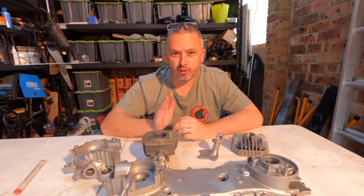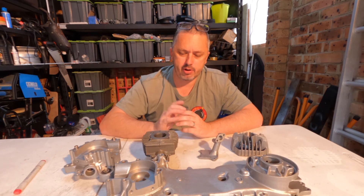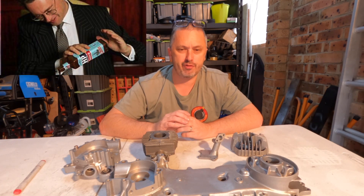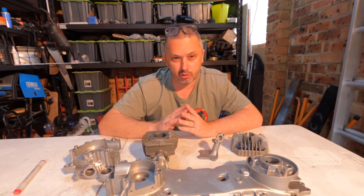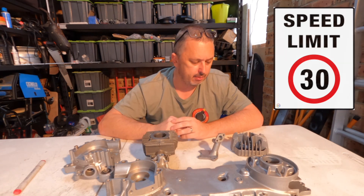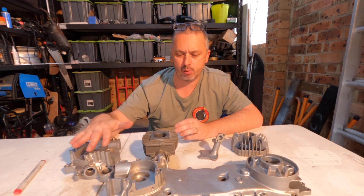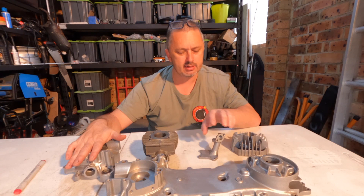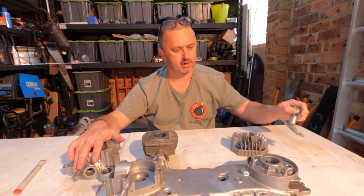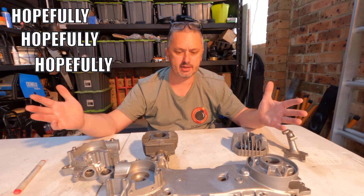What we're about to do before we start reassembling the motor is get it ready for reassembly, and by that I mean we might attack it with a die grinder — see if we can squeeze out a few more horsepowers or maybe a few extra kilometers an hour. The tiny little Moto Compo was speed limited apparently to 30 kilometers an hour, so I'm going to see if I can get a little bit more. We'll do a bit of case and port matching with the cylinder and the cases, and see if we can squeeze a little bit more out of it.